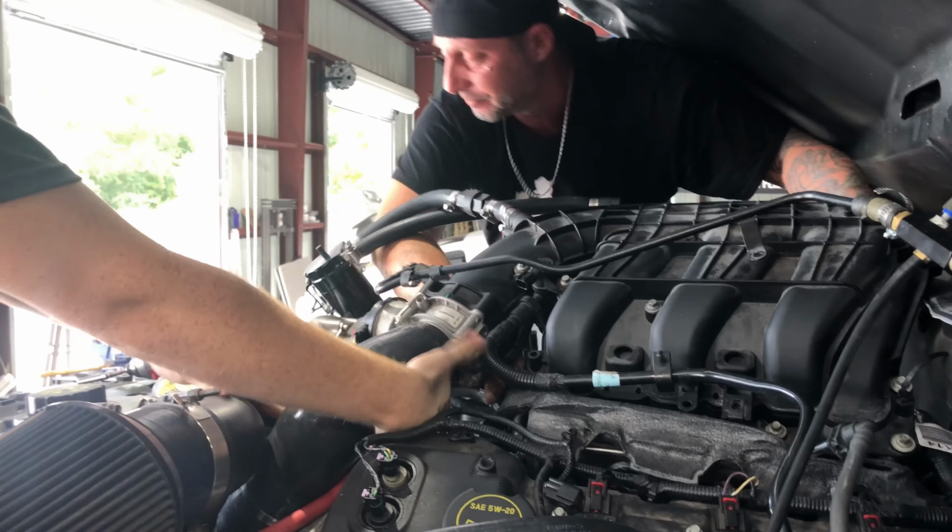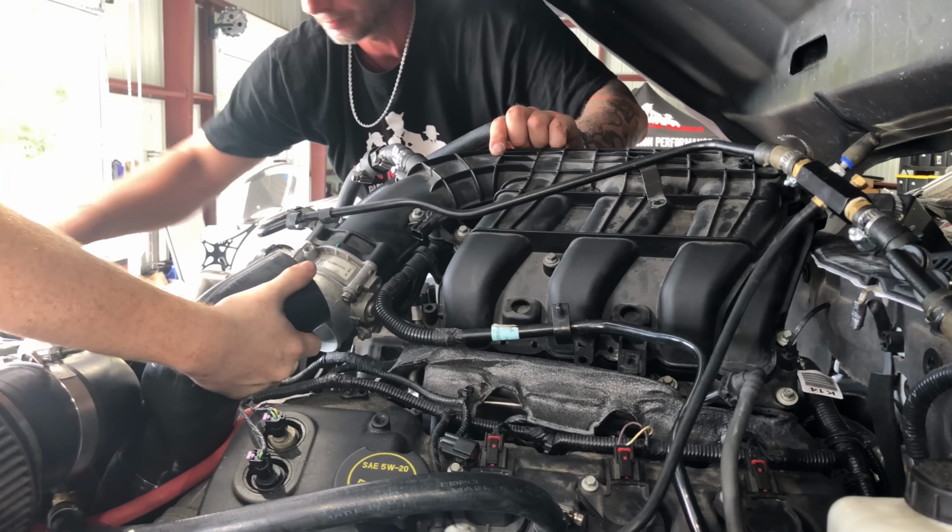So you see right now the intake's going back on. Reason for that is the spark plugs, which we were told were gapped correctly and were new spark plugs, weren't new. We replaced them and they were gapped at 035 instead of 028. So we were getting some blowout. So we pulled them off, we replaced them with new spark plugs, and we gapped them correctly and we're installing them now. So this should fix our issue of breakup and the car should make a little more power. We'll get closer to that 400 mark.